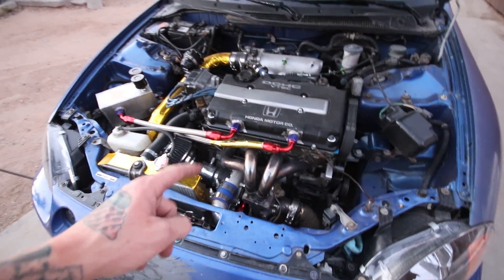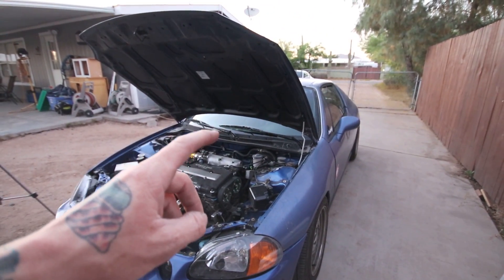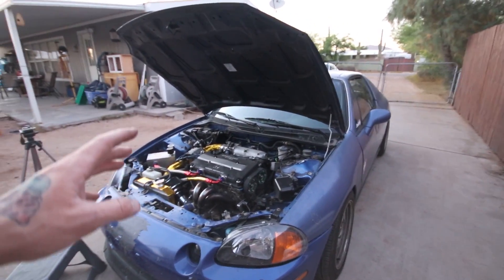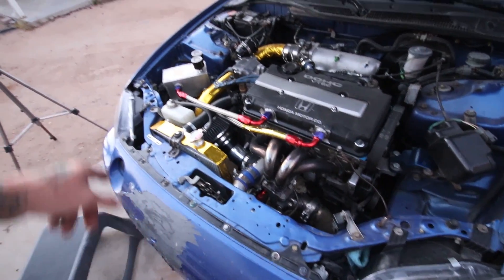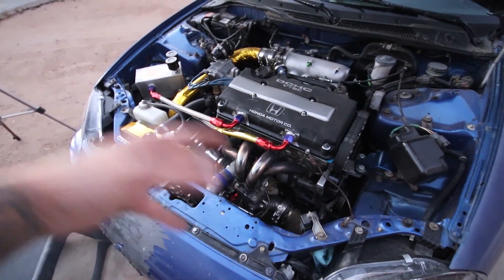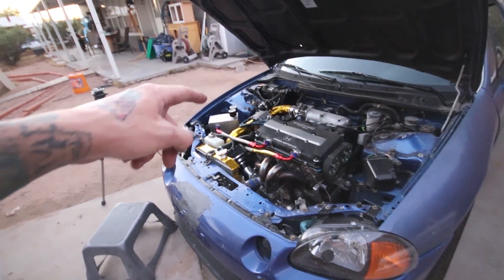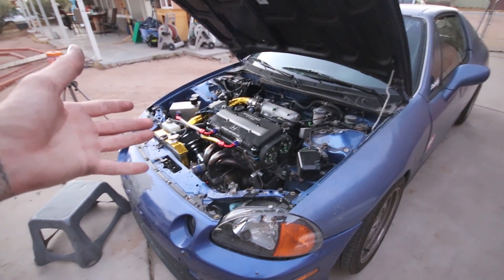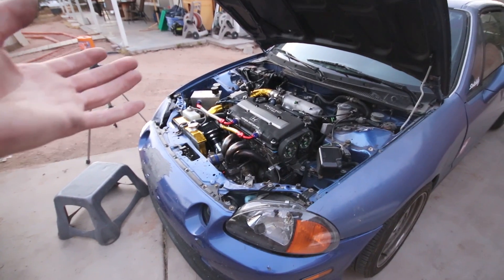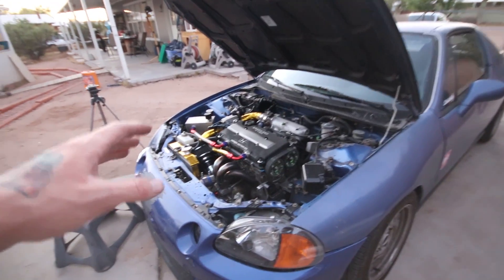It's holding out pretty well so far with no issues with the turbo. I do have one issue with the car though — on deceleration, occasionally I'll get a puff of smoke out the back. I've already diagnosed it and it's not the turbo. I have no shaft play, no oil in any of my charge piping, and no oil in my downpipe — I found my Garrett turbo was bad when I popped the downpipe off and it was filled with oil. I think it's more of a ventilation issue from the lack of a PCV valve or my valve seals starting to go. I just pull it out of gear and brake normally since this isn't a race car.